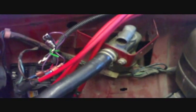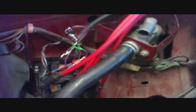It still uses the remote coil, same high output plug wires, and we mount the remote coil pack over on the firewall in the position that the original coil mounted on, so we have ease of hookup there because the tach and power connections were in that location.